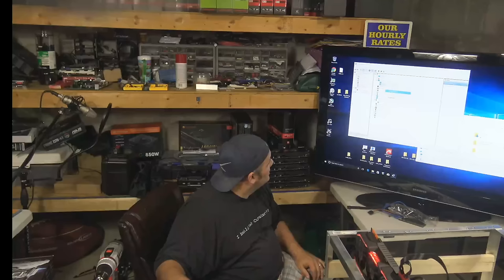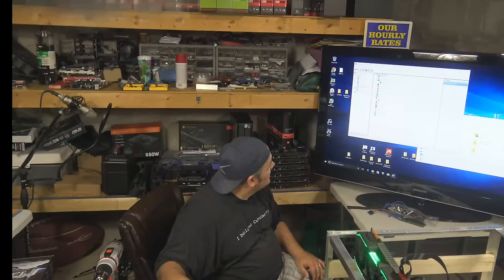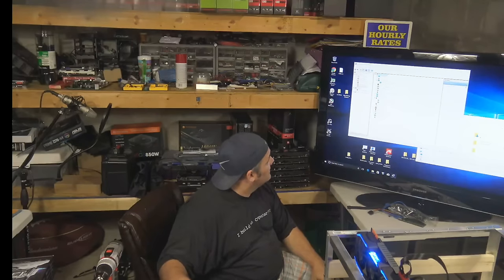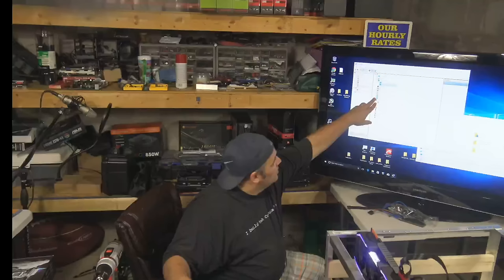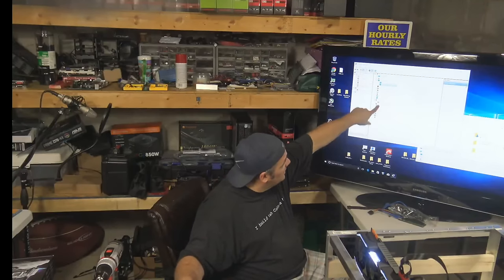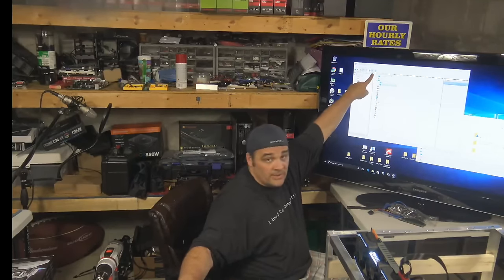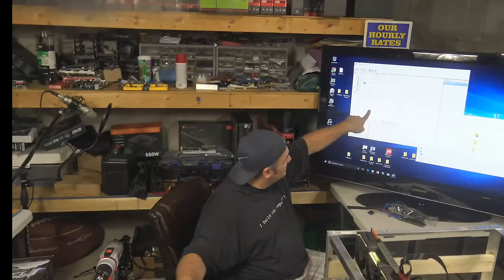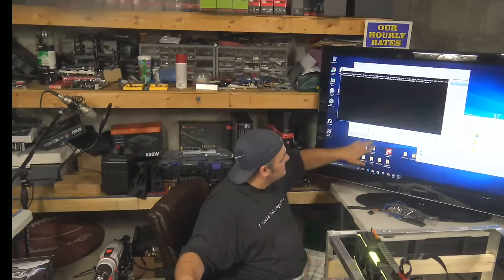So what I'm going to do is uninstall it. I'm going to scan, let it set it back up, make sure it works, make sure it hashes, and then I'm going to pull a cable again. All right. So with me uninstalling it, I just right-clicked, hit uninstall, it dropped it back down to other devices. I hit scan for hardware up here, which went out, grabbed the driver, and then reset it without the exclamation point. Now it says it's working properly. So let's go ahead and fire up real quick just to make sure it sees it. If it does, I'm going to shut it back down and pull a cable and just see.